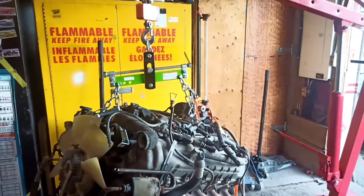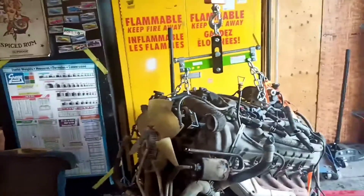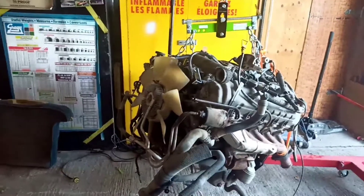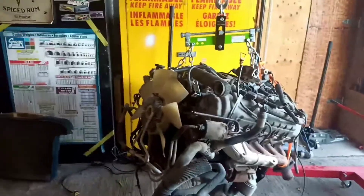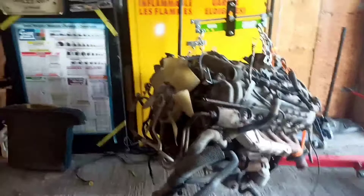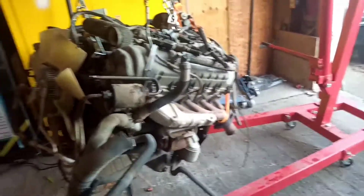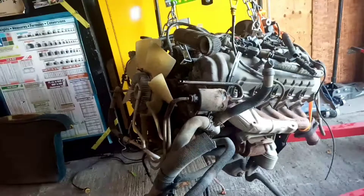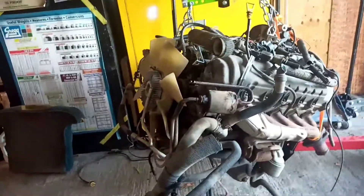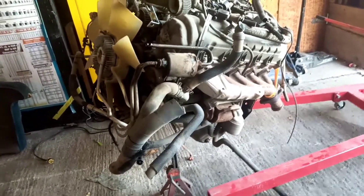At 717 pounds, that's pretty much 300 pounds heavier than the Coyote V8 — almost like two Coyote V8s. But the Coyote doesn't have the clutch fan, doesn't have an AC compressor, and its exhaust manifolds are a light tube style I made super thin. This V10 still has the down pipes, a probably 15-pound clutch fan, AC lines and compressor adding maybe 20 pounds, and those huge motor mounts with a big slug of rubber versus the small lightweight ones on the Coyote.